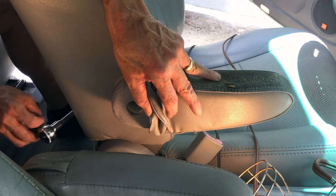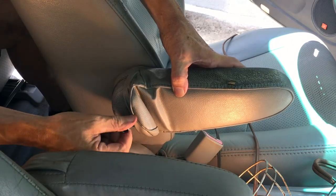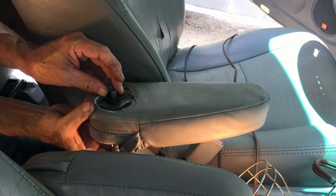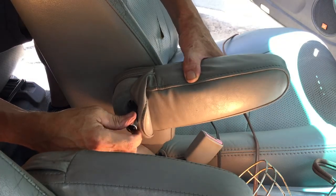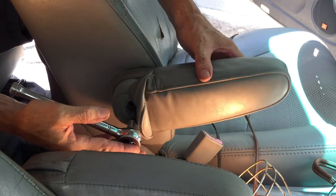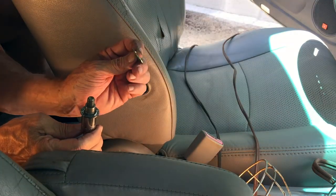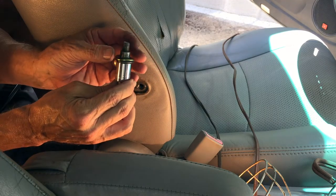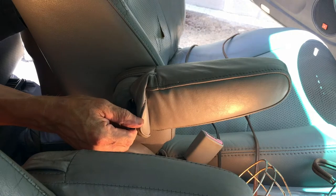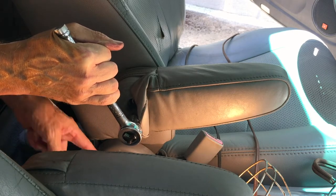Fold it back so we can get to the bolt — it's 14 millimeter and you'll need an extension or a deep socket. Watch out for the plastic washer on the inside. The armrest was loose even with the bolt as tight as it would go. I found the problem: one of the washers — which is not perfectly flat, it has a little curve to it — had fallen out onto the floor and slipped in between the seat and the center console. Once that curved washer was back in place, the arm was tight. So watch out for that washer that's not perfectly flat.